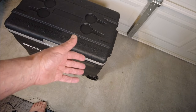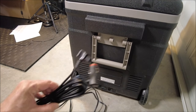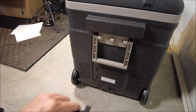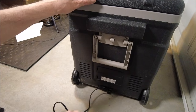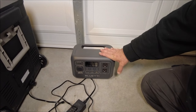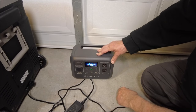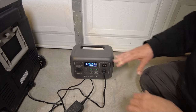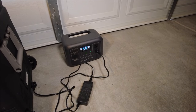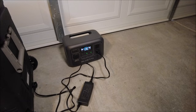So let's take a look at the controls on the side, plug it in, and get a power station going to show you what it draws. To get this thing going, you're going to decide if you want to use the cigarette lighter adapter plug or the adapter plug to plug into the wall for AC power. I chose the smallest Bluetti that I have — this is the AC 2A — just to show you that this does not need a ton of power to run. I'm going to turn on the unit and plug this in, turn on the AC. I'm seeing I'm drawing 62 watts, and I have this going down to minus 4. It dropped to 61 — it's about 62 watts.